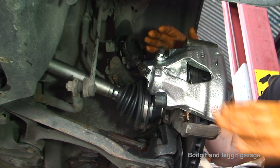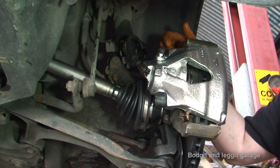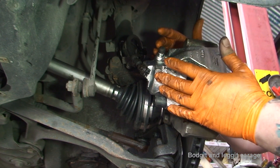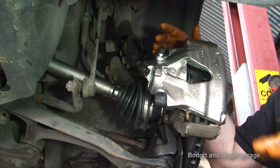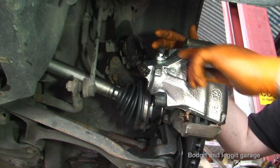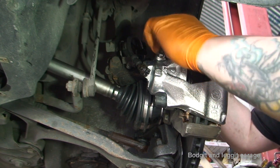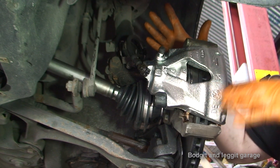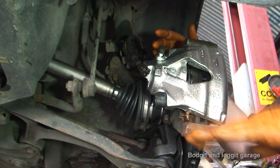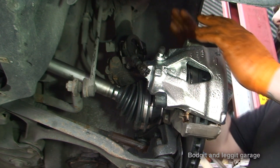I'm going to wedge the disc with a screwdriver and tighten up this bolt for the main drive shaft. I have done videos on how to bleed brakes — even though we've completely drained the system, it's essentially the same process. I'm not going to show you bleeding them. But what I suggest you do if you've done this the same way: loosen the bleed nipple, fill up the reservoir, and do this one brake at a time — open the bleed nipple, wait till fluid starts coming out naturally by gravity, then tighten it up. Do it to all the brakes you've replaced, then pump them properly and actually bleed them.